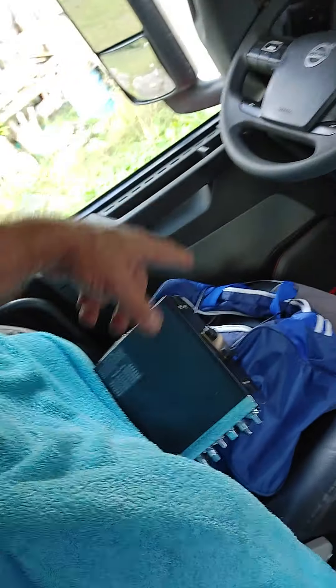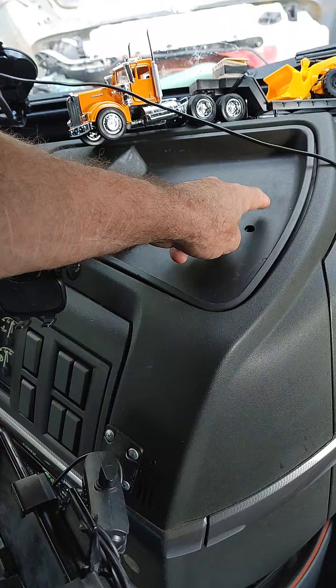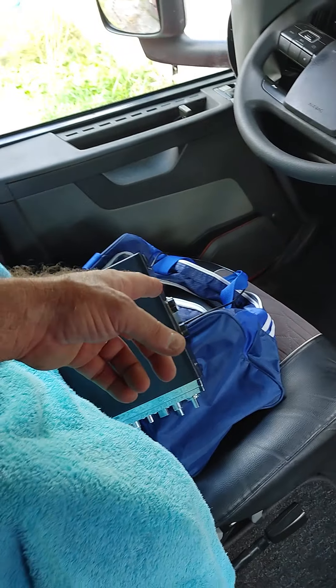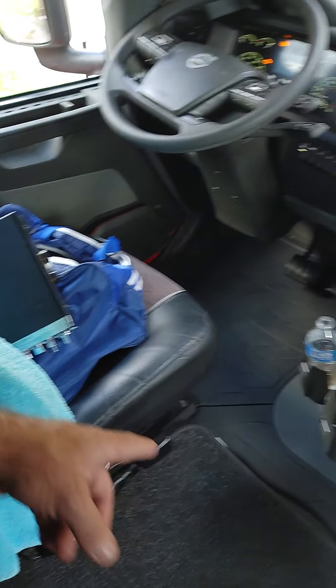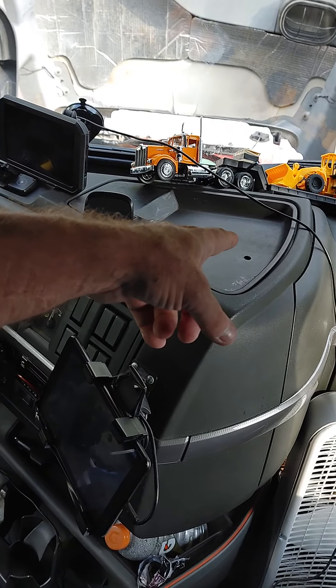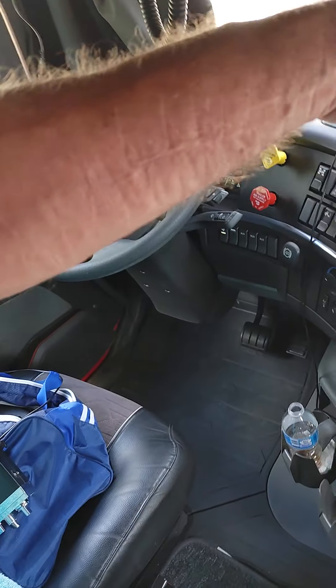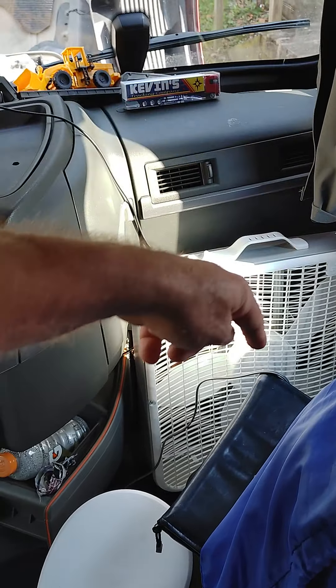It don't have to be to the battery — the battery's the best. I think I have enough cord, I can go down through and drop out right over there and come out over the top of my battery and ground it right at the battery. But I'm still going to grab my hot right here, cause you're hot — it doesn't matter. I'm getting straight voltage off the battery, which is exactly what I would get if I run the hot cord all the way down. My negative — I'm either going to run down through the dashboard and connect to the battery on the negative side, or run down through the dashboard, come out over there, drop down, hook to the frame — anywhere. It doesn't matter, as long as you get a good ground, you're grounded firm, and you won't hear none of that.